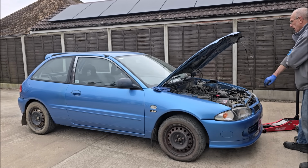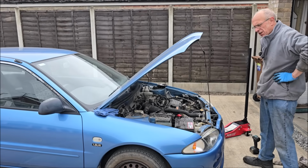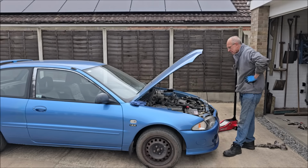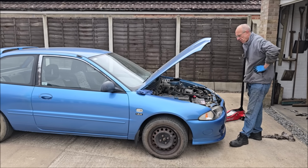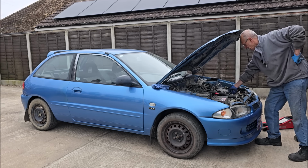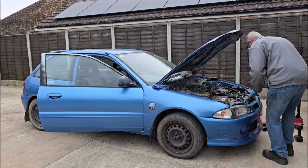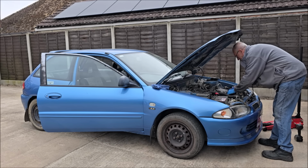You know what we're going to do now? Cylinder leakage test. No, we're going to run a compression test on it again. I don't know, it sounds a bit flat to me, but the compression test doesn't always show tight valve clearances. Yeah, it's down on that cylinder. Let's just whiz your compression test on it again.